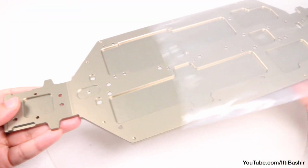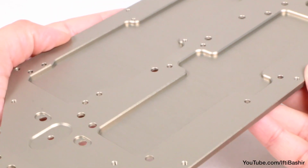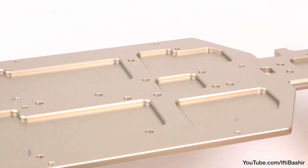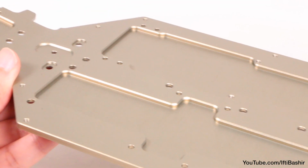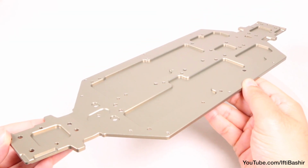We also have the main chassis, which is expertly machined, 4mm thick machined aluminum for lighter weight yet high strength, pre-holed with cavities built in for mounting various parts and electronics further down for a lower centre of gravity, providing higher stability when racing around corners. Each electronic component has its own space on the chassis to minimise the influence on chassis flex too.